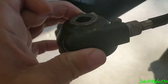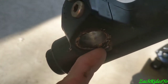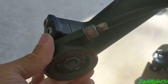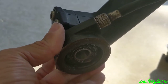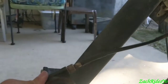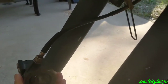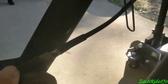Another part of the problem is I have seen even shops do this. Jim's bike is currently this way. You see this little nub sticking out right here? See these two nubs here? When those two nubs on the speedometer housing slide across either side of that one on the fork housing, you'll see people that have them bent like that, which puts too much stress on the cable and breaks it. It also tries to spin forward with the wheel, which breaks stuff really quickly.